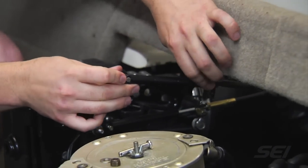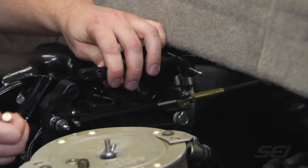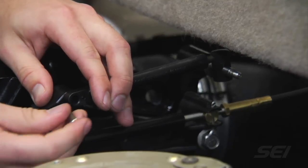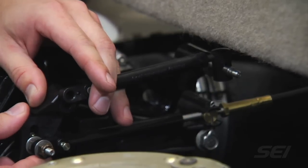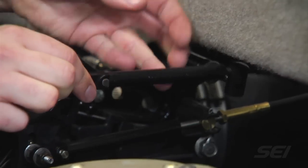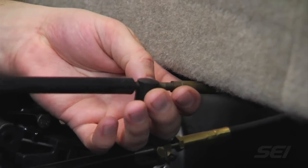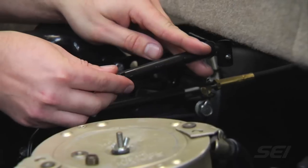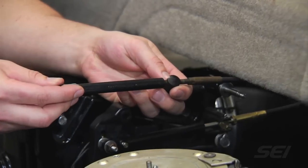Now we're going to fit this cable to check for alignment, pushing the lower shift cable to take the slack out. While taking the pin and checking alignment — pulling on the top cable and pushing slightly on the lower cable to remove the slack — we'll check for the pin. It looks like we're off by just a couple of turns, so we will adjust at the barrel. After tightening the barrel, we remove the top cable and the barrel needs to be rotated four turns away from the cable end guide, then we lock it down.